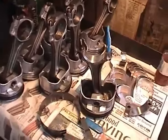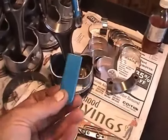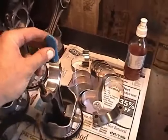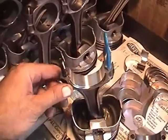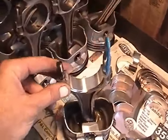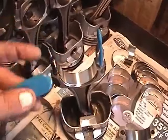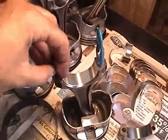I'm prepared to install the pistons, and there's a few goodies here I want to make you familiar with. First of all is the rod bolt protector, which is just a little plastic sleeve that you install right over the rod bolt. What that does is it protects the crankshaft from getting scratched while you're installing the rod into the piston hole — it'll guide it right up over the crankshaft without scratching it and helps align it. Make sure you pick up a pair of these at your machine shop when you buy all your parts. They usually will give them to you free, or you can just use a piece of rubber fuel tubing — that'll work too.